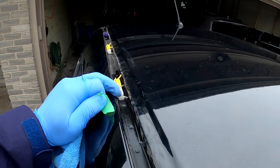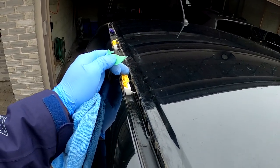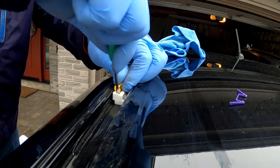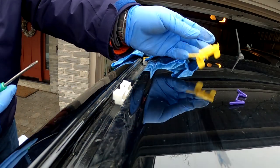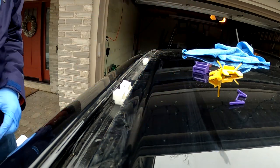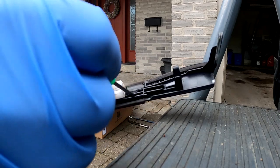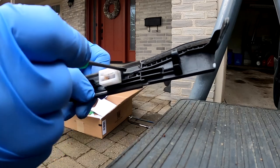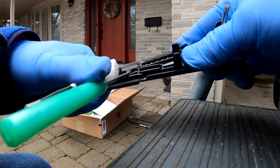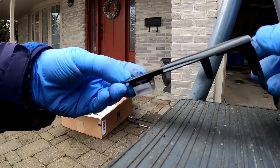You leave the white part in place. You do have to pull the outer clips out — they're not clipped in too strongly. You can pull them out with a pair of pliers or use a tiny screwdriver to pry them up. To remove the back part of the trim, you just need a small screwdriver. In front of the white piece there's a little tab — just pull up on it and it's a bit stiff but it'll come out. That's the only piece you need there.